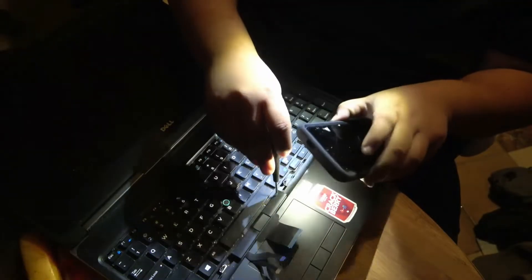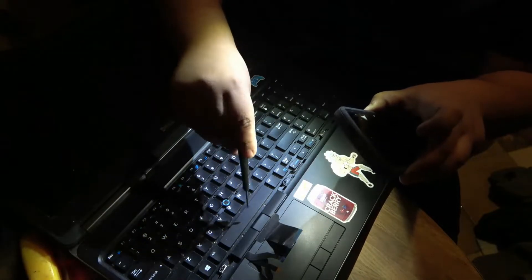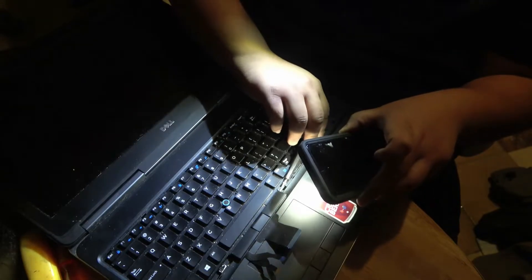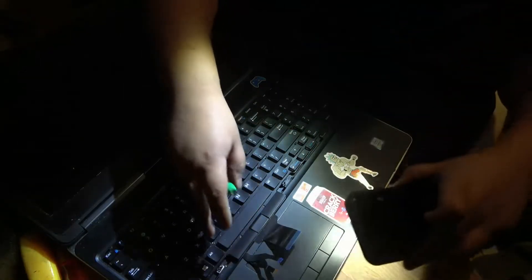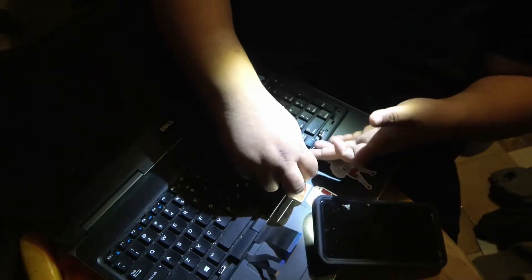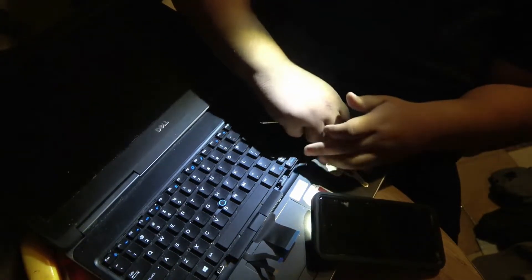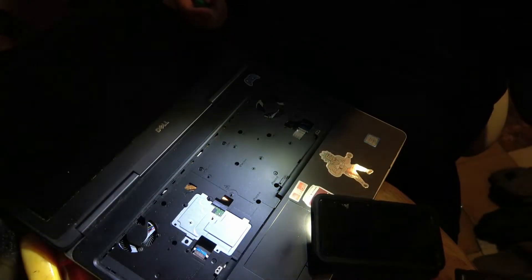So the palm rest is here — the buttons for the mouse and the palm rest area. I put a screwdriver in just a little bit, lifted it, got my finger in there, then did the same on the other side and gently started picking up the keyboard. Then just pop it — because there are clips on the sides holding it in — and that's pretty much it.